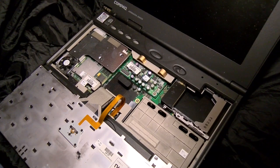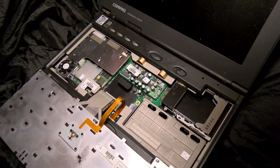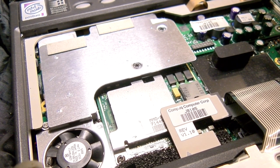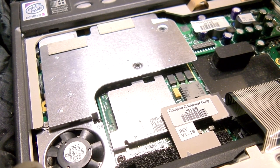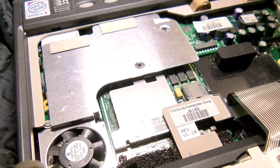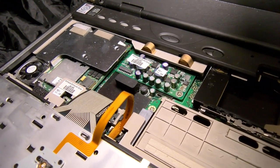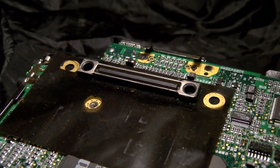Where the hell is the Northbridge? That's part of the MMC1 module the CPU is located on - it's an Intel 440DX. It's no wonder it works, as this suggests it belongs to the same family as the desktop 440BX, a chipset very well-known and well-loved for the fact that it almost never breaks. Any device using these CPUs has to use the 440DX - but if you're going to be stuck with one chipset, you might as well be stuck with a 440.